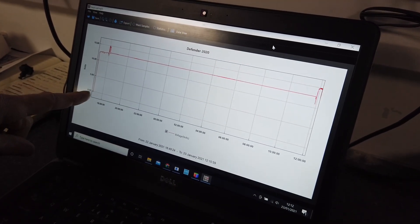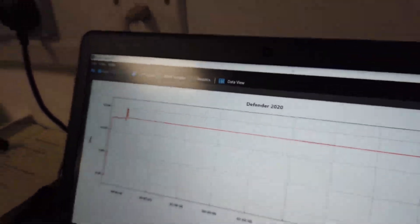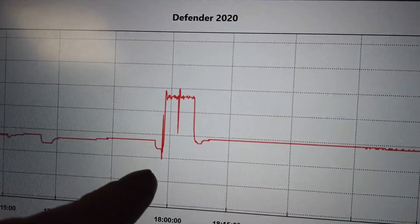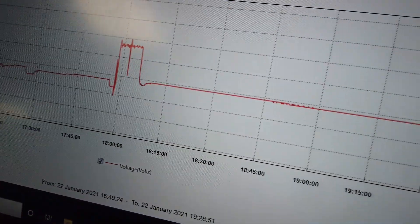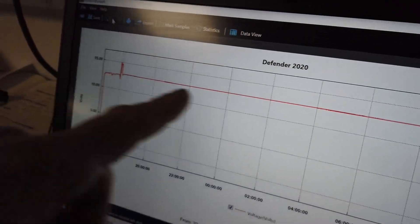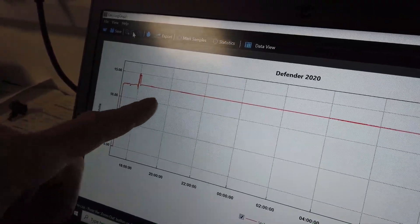This was yesterday evening. This bit of low voltage is before we plugged it into the car. Then we plugged it into the car, and then this was my short drive home. You get the little dip in voltage — let me analyze that a bit more closely. So this was when we plugged it in, then the voltage drops for the starter motor. Then I drive home — there's a bit of a ripple there, somewhere maybe I had a stop-start cycle on the way. Then the voltage goes down. Then it went all overnight. So let's zoom out again. That voltage doesn't go to sleep — there was some speculation that the voltage on that take-off in the headlining would go to sleep, but you can see here that it remains live all overnight.